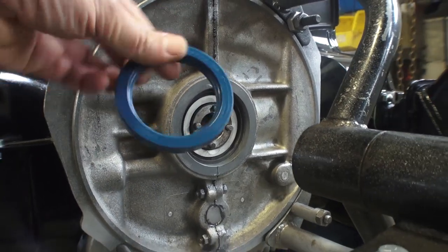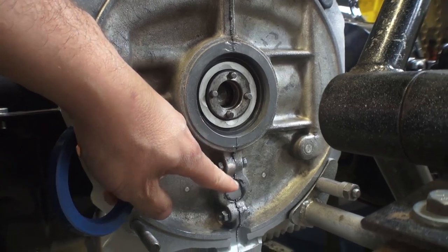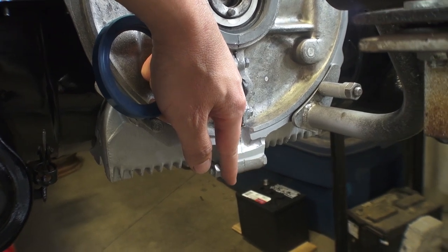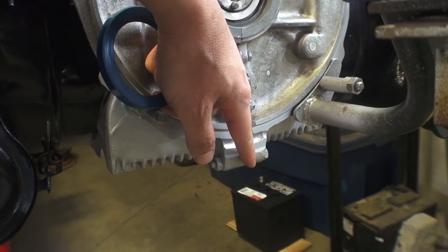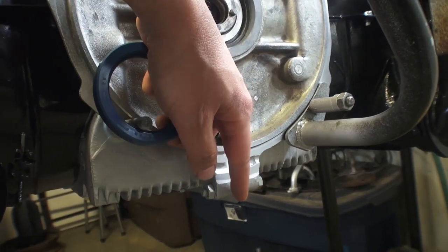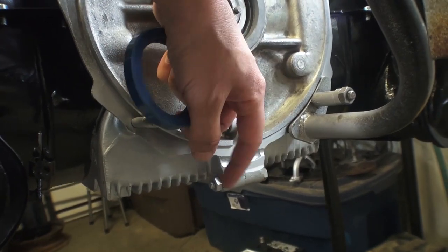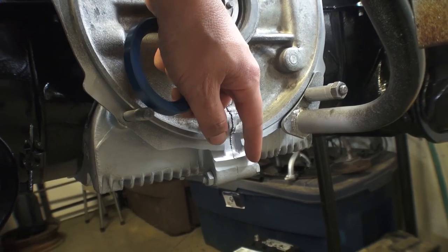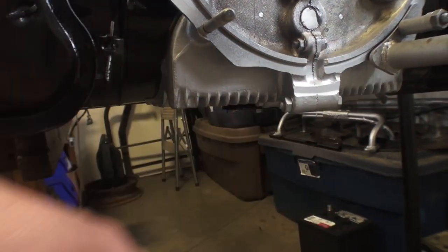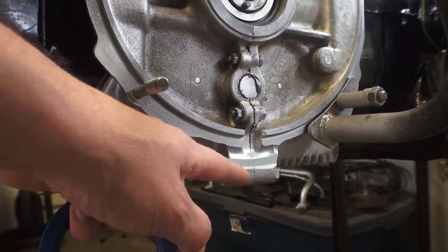A lot of times, even when you have your motor in the car, oil will drip past the seal. All the way down and you'll see it underneath the car — drips of oil over here in this so-called back nut area. People call it the back nut area; you can call it the front nut. This is actually the nut that's closest to the front of the car, so usually it should be called the front nut, but most people call it the back nut under the motor. A lot of times you'll see it leaking oil here, and when you're driving the car, of course, the oil splashes in different areas underneath the motor or even gets pushed further on the tunnel of the car, so it looks like there's oil everywhere, but for the most part it's just coming from there.